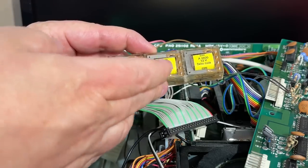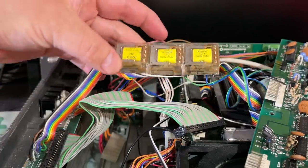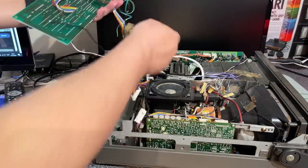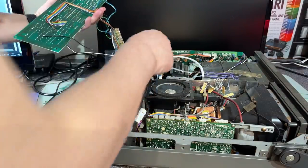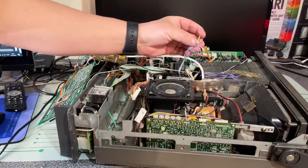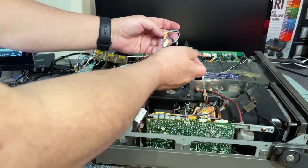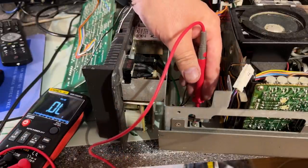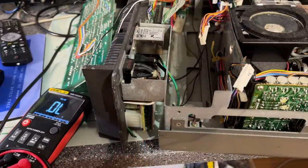The things I thought were small transformers are actually relays — something is being controlled by them. When I untangle the wiring, it seems like nothing is connected to power on the floppy disk controller card, while the rest seems connected. I notice some wires labeled plus, ground, video, chroma, luma — some sort of video output arrangement. That loose grounding wire — I checked and it is connected to ground on the machine, so no danger there.